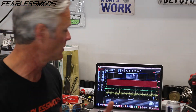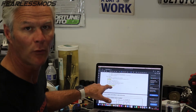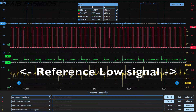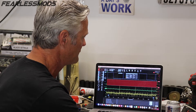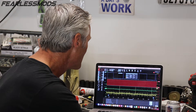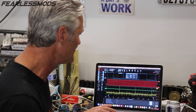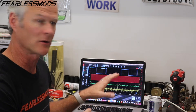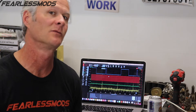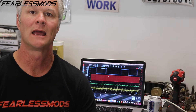As for the reference low signal, it should be zero volts but it has a star, and that star says less than 0.5 volt. If you look at what we're getting here, our center line is essentially at zero volts, and with the spikes occurring — the ones down here are about 0.2 volt and the tall spikes that appear to occur once per cylinder are at roughly half a volt. So by double-checking the manual against what we're seeing from the Picoscope, the signals coming from the PCM are exactly what we expect going to the Opti, which makes it even more evident that we've got a secondary ignition problem.